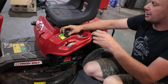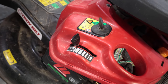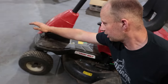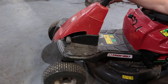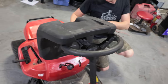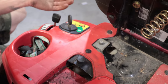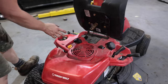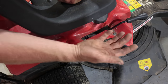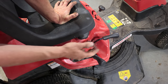So we've got a battery in place, but now it won't turn over. Lights don't come on, the hazards, and it won't turn over. Now these things are very meticulous for safeties. You want to make sure that it's in park — foot all the way down. There's a lever on the right that does the speeds; make sure that's down into the P. Every one of them will have a seat sensor on it, meaning that as soon as you get off the seat, it won't start. Also, if the deck is engaged, it won't let you start it that way either.